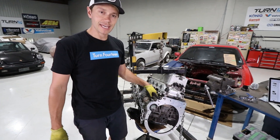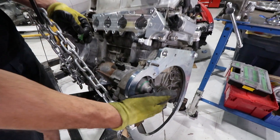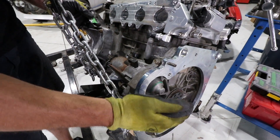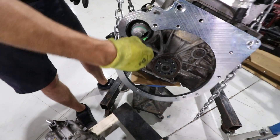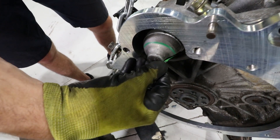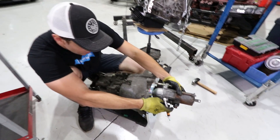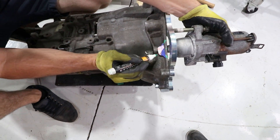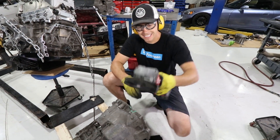It's now time to bolt up our K-Miata adapter for our BMW transmission onto the K. The first thing we're going to do is deal with the starter issue, which protrudes into the actual bell housing of the BMW transmission. Normally that wouldn't be a big deal, but because it's offset on the K-Miata BMW transmission setup, we actually have to cut out a little bit of material. I've figured out where the starter will bolt up, marked the area on the bell housing, and now I've got the Milwaukee grinder out with the cutting disc - let's make some noise.